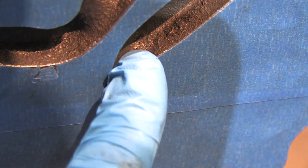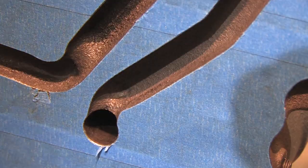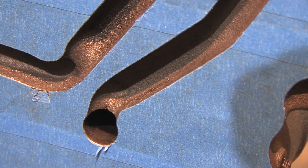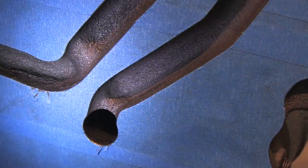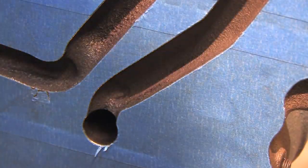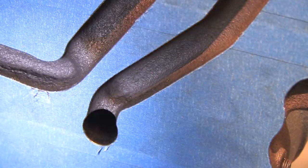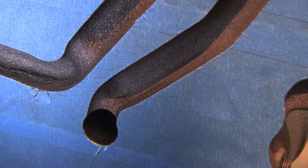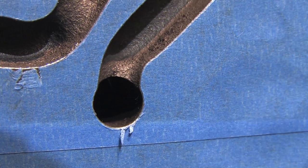I'm also going to contour those areas based on their flow direction. This one is the regulated main oil gallery. Oil makes a sharp 90-degree turn here inside the block. The hump you see going across both galleries is the oil supply for the number one bearing, the rear balance shaft, and your oil pump. Under no circumstances do you want to cut into that gallery on the high pressure side because it trashes your block.